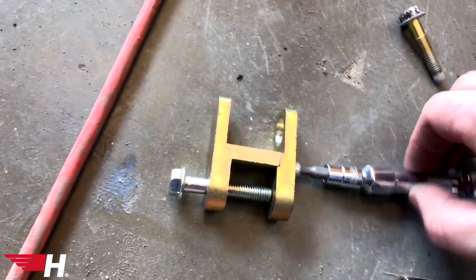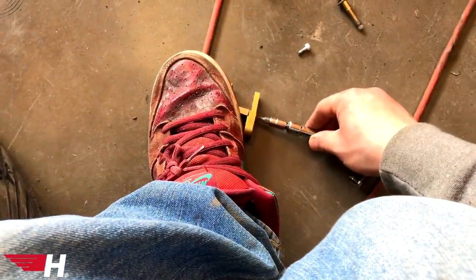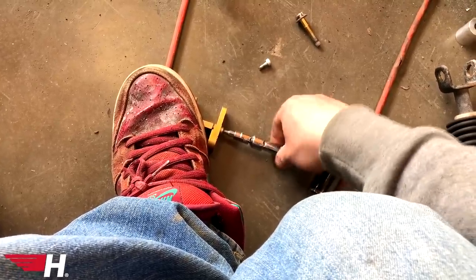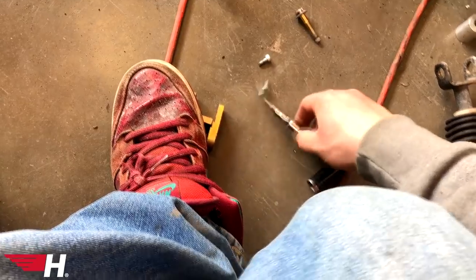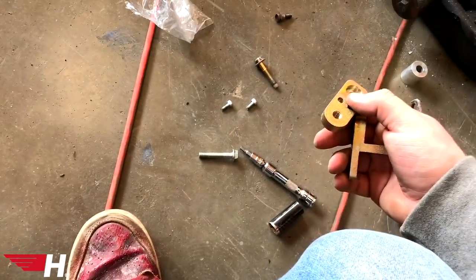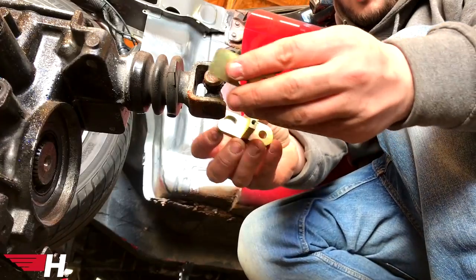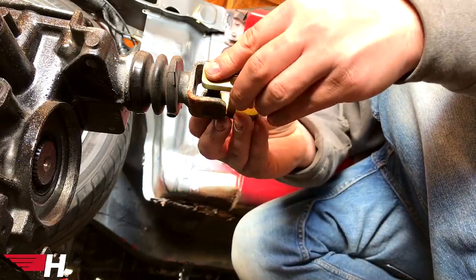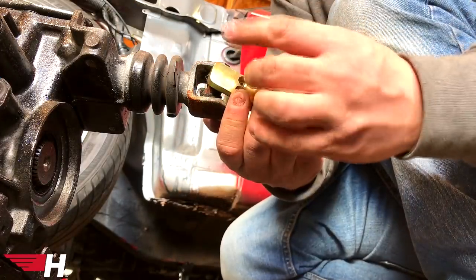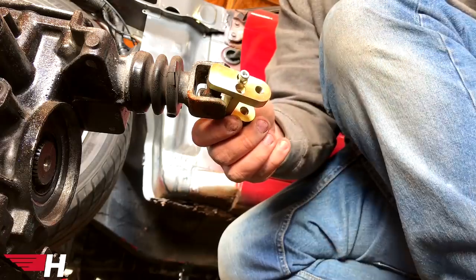Once you take this out of the bag, undo these two bolts right here, 4mm. Undo these two Allen key bolts, which is kind of hard to do with one hand, but I need a tripod, guys. So you undo these two, easier with a socket. Grab yourself a set. Undo those. That comes out. Undo this bolt. I wouldn't leave these on the ground if I was going anywhere. If you guys are moving around, keep that stuff in the same spot. Just clamp on like this. Wow, that actually fits really good. I am impressed. Thoroughly impressed. All you do is put your little Allen key bolts back in there. 1 and 2.